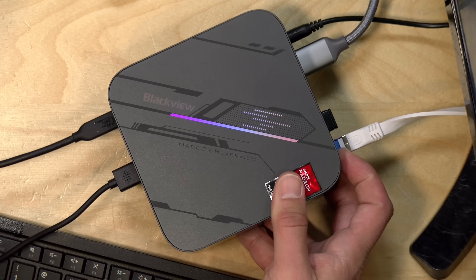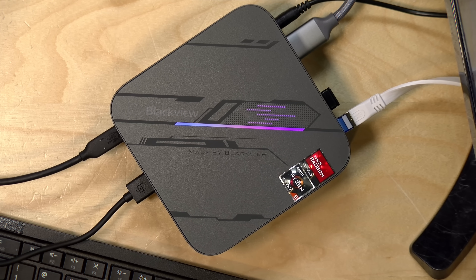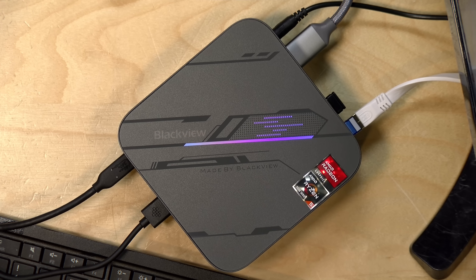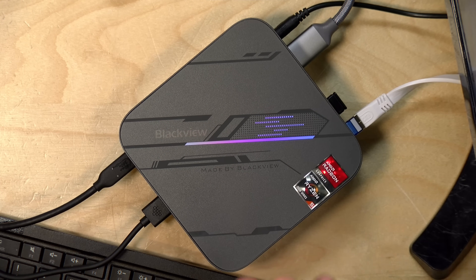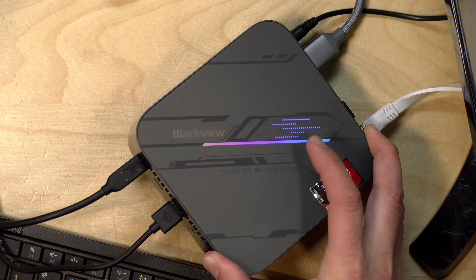All in, it's a nice little computer. It was really disappointing that they included so much RAM but put it all on a single stick. It is a significant performance decrease on the graphical side when you only have a single channel of memory on these little Ryzen boxes. It would be great if they could just split the RAM up and keep the price where it is, because I would have been very excited about this price point if the RAM was configured differently. It's got a three-year warranty as well. Altogether, if you don't mind spending a little bit more to pop in another stick of RAM, I think you're going to have a very good experience with this one. Until next time, this is Lon Seidman — thanks for watching.